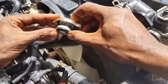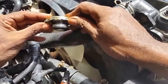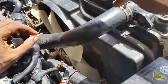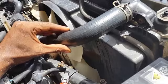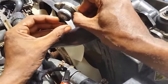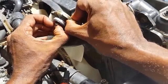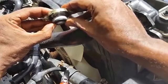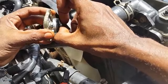We're not experiencing an over-pressure situation. We're experiencing a vacuum situation when the engine becomes cold, because the hose remains collapsed. This is caused because this bleeder cap is not allowing the system to bleed itself off during expansion and contraction.